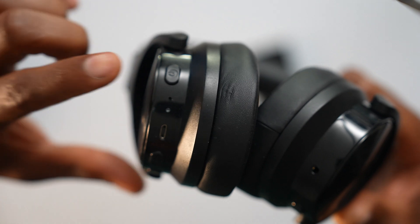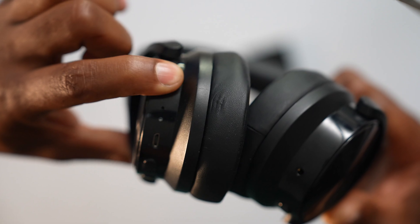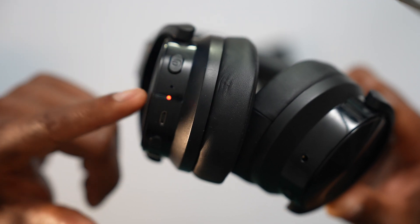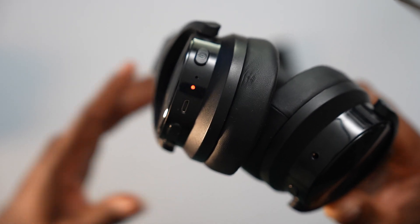If you are trying to connect your Bluetooth headphone to your phone and they won't show up, let me show you how to get that fixed. If it is for the first time, you have to do an extra step to connect it, and this will apply to any kind of headphone. You're gonna press and hold down the power button until you see the LED flashing between red and blue, or sometimes red and white. That LED flashing lets you know that Bluetooth is on, and that way they will show up on any phone or device.